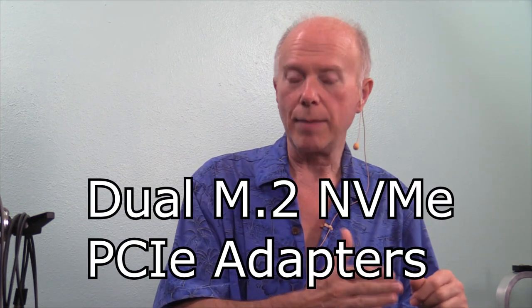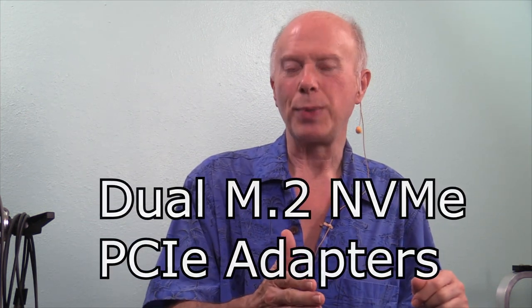Okay, this video is going to be about dual M.2 NVMe PCI Express adapters. There's going to be bifurcated and non-bifurcated. The requirements are going to be either a 16-lane slot or an 8-lane slot electrically. When you have a card that is bifurcated, it's going to be more expensive. When you have a card that requires motherboard bifurcation, it's going to be less expensive. And we've also got some cards that are already populated with memory.